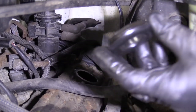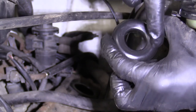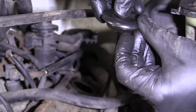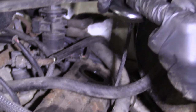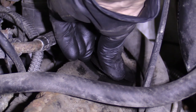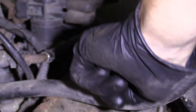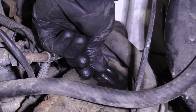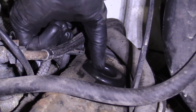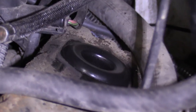That looks pretty great. We'll take our grommet — this side goes down. The nice flappy side, the bigger area, goes on the top of the valve cover. That's going to help keep moisture from getting in. Take our grommet, start from one side, just kind of help it along. Push down, push this way and down — in towards the center and down. There we are, that fit in there great.